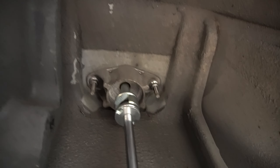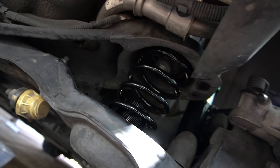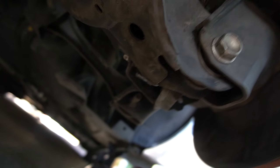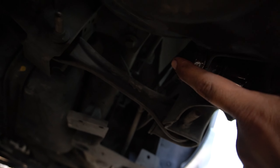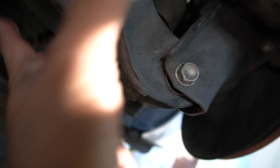I just finished the rear — camera died so I didn't get that on film, but let me show you what to do on the rears. This is the wheel obviously. First thing, take off these two 12-millimeter bolts right here. After those two, take off the 17-millimeter bolt. You go under where the shock is and take off this 17 and this 17.